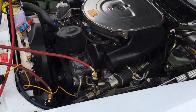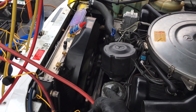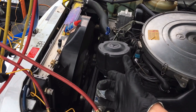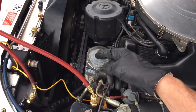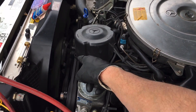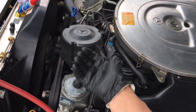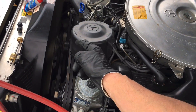The thermal fan clutch — after 30 to 50,000 miles it looks really good right now, but it took a real long time for it to work. This is where a non-contact high-quality thermal imaging gun comes in — not the cheap $19 one. Don't even trust ones in the $400-500 range. Some of the $150 range ones — when you take the temperature of something shiny and metallic, it has emissivity, which is the reflectance of heat, and it doesn't like to take a really accurate temperature. Hot air going over their optics distorts them and gives you a false reading.